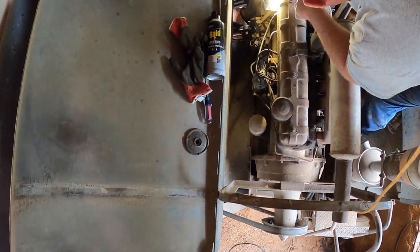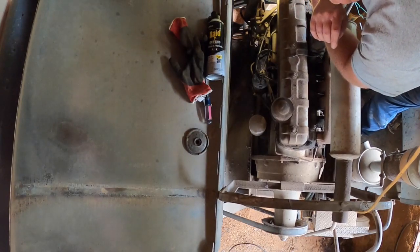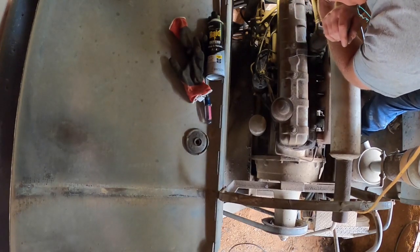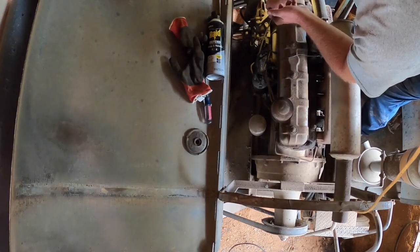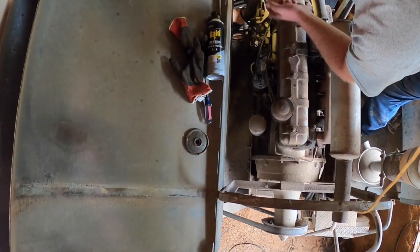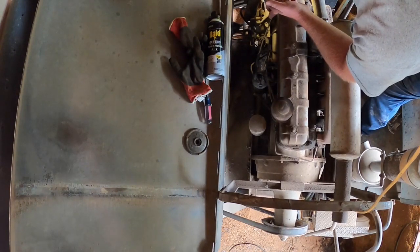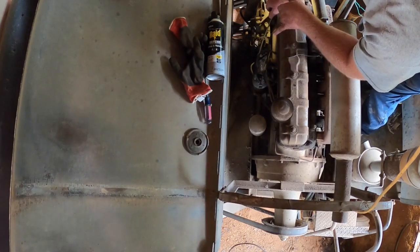Guys, I got the coil back on, resistor, putting stuff back like it was. They're down there wide open trying to swap a dump body over on a truck they just bought. I can't remember what he said, if this coil is bad or if they borrowed it and brought it back. I don't remember, but we're gonna hook everything up, clean the points up just a little bit.